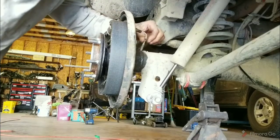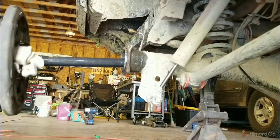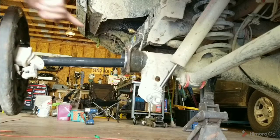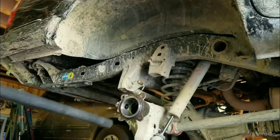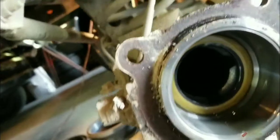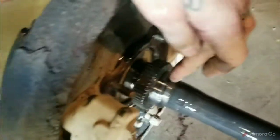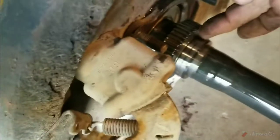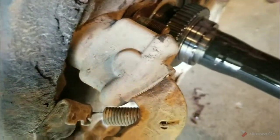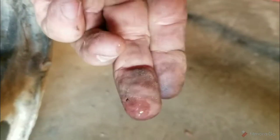Once you get your brake line secured with your little plug, I've got the four bolts out from the end of the axle. There's a little tone ring there for your ABS. The offending axle seal is inside the axle — there's a seal right in there and that's the seal that gets to leaking. I will pop that out and put two new seals in. They seal up against this surface right here where I've got my finger on this ring — you can see the shiny part. You can tell by all the fluid on this tone ring that it was leaking, because that should be dry. And it's wet, wet, wet.